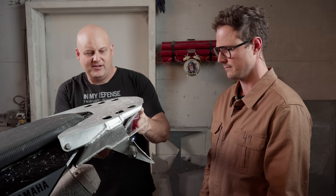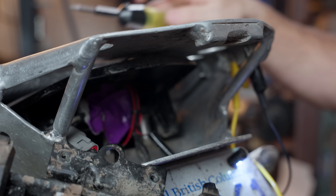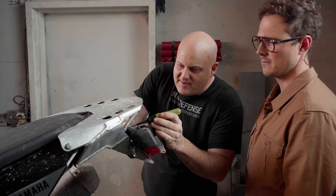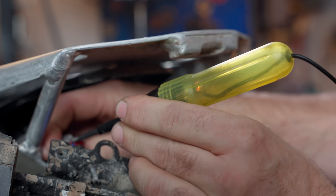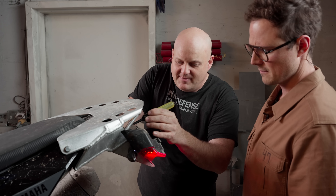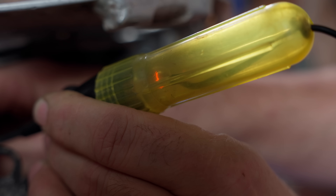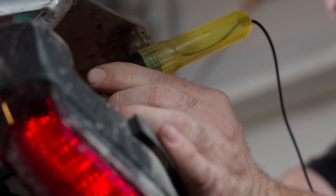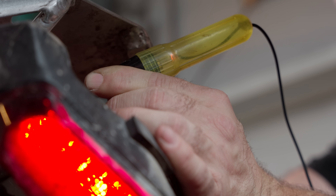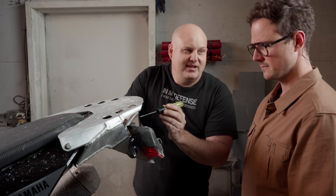Let's pop it out — I've already loosened the screws. We'll slide this back here. We've got our handy dandy test light, grabbed it to the rack. I know this rack's grounded. The first thing to do is find some power — make sure the test light illuminates from something. I'm back-probing inside the ground connector. Our test light is kind of dim but it's on, and we have full brightness on the tail. Because we have an old-school incandescent test light — a modern LED taillight needs so little power that it's grounding through the bulb and completing the circuit. That tells us the ground isn't flowing power properly.